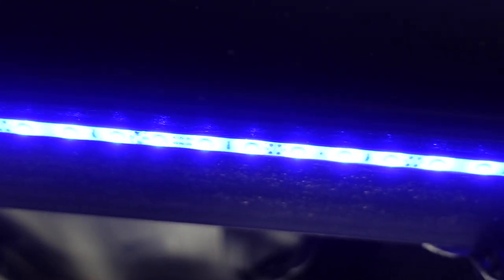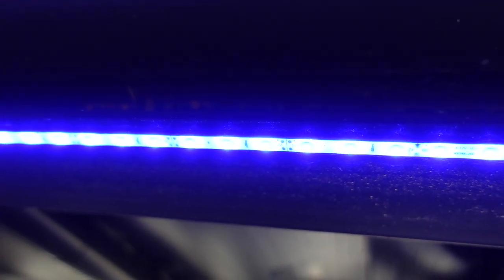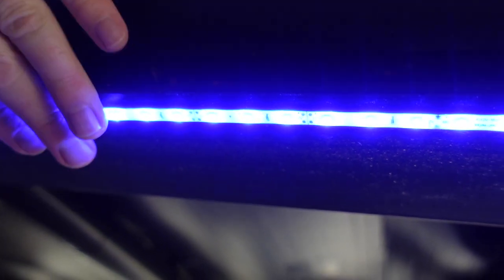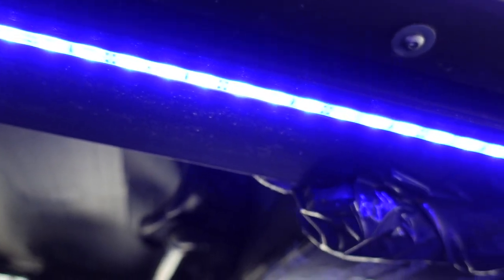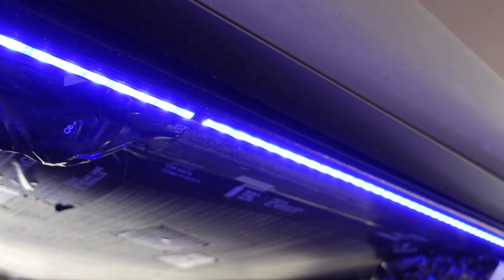There is a limitation with the BM Pro system — you can only have so many watts or amps per channel before you get an error message. That was one mistake I made. I had initially bought a different strip of LED lights, and when I dry-fitted both sides on the channel, I got an error message on the BM Pro system and it would cut the power. It was a pretty generic message, something like 'service your node.' I realized it was detecting too much amperage, so I had to go with a slightly different LED strip that didn't consume as many watts. I'll put a link to that strip in the description below.